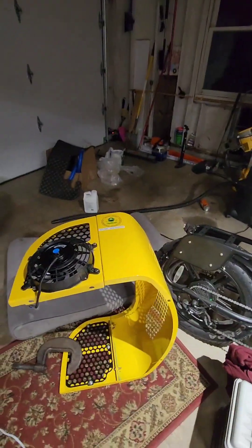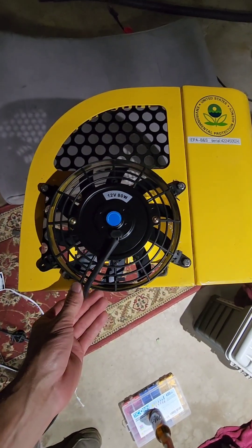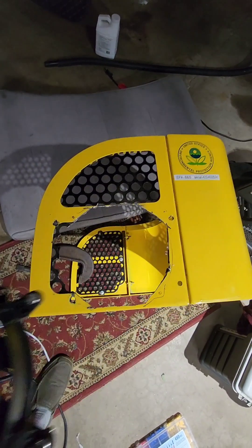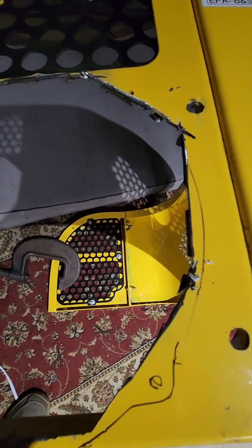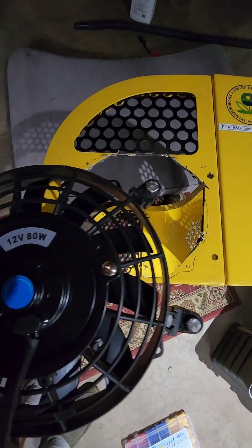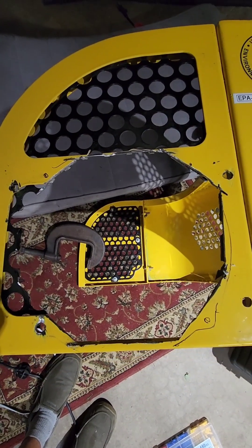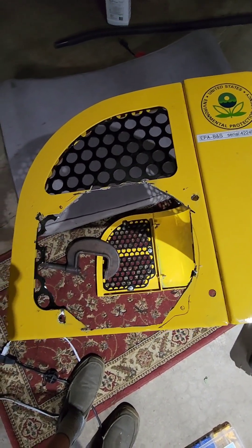This cover is probably the hardest part of the job. Put the fan there, marked around it with a Sharpie. We've got some bolts in here already. Then hacked at it with an angle grinder. This is the inside — it's still marked. I didn't use that inside bolt hole. This fan came with ears that you can attach, so get four quarter-inch bolts in it, put the nuts on the backside. Wired up — see how it goes.